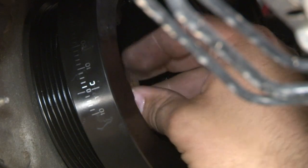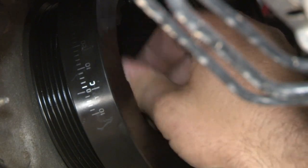Now we can install the factory bolt with the factory washer. Make sure you get a bunch of threads and know it's right. Once you get the factory bolt threaded in, you'll want to grab your torque wrench. Ford revised the torque specs for the crank — the new torque spec for '98–2003 is tightened to 66 foot-pounds, one full rotation loose, then retightened to 37 foot-pounds and a quarter rotation tighten.